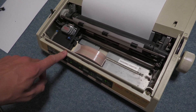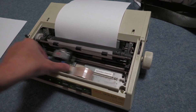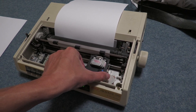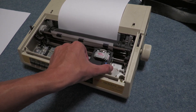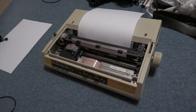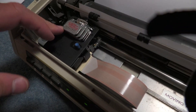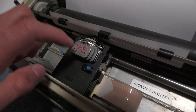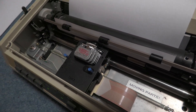It would print, but only ridiculously slowly — do one line, then sit and wait for ages, then go back and do another line, then sit and wait for ages again. The manual says it might be a temperature issue, and these heads can get quite hot. There's even a 'caution hot' warning on it. There's actually a thermistor in here which connects down onto the printer's circuit board to tell the printer how hot it is.